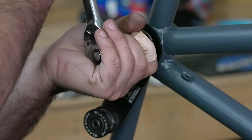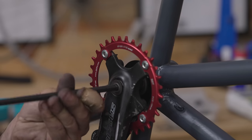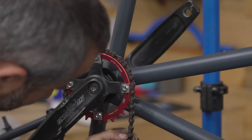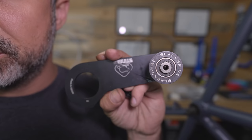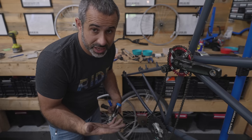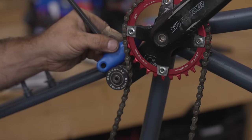Now for the complicated part — the drivetrain. I'm going to install both cranksets and run a chain from the top bottom bracket down to the bottom one, and then another chain to the drivetrain. I think it's going to look cool and work great with really good shifting. Here's the reason why we need the bottom bracket mounted chain tensioner: we can adjust the length of the chain but it's never going to be perfect — it's always going to flop around. This particular chain tensioner stays in place with pressure; you just screw in the bottom bracket cup over it and tap it into place. This is not a high-performance bicycle, so I'm not too worried.